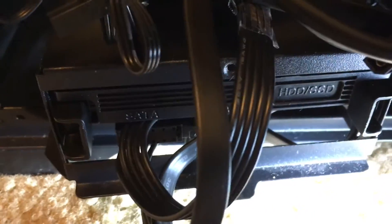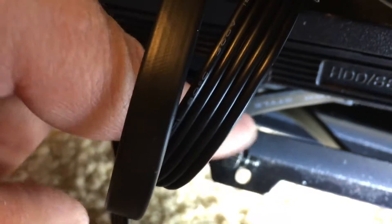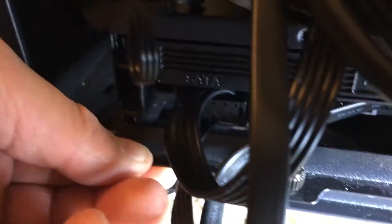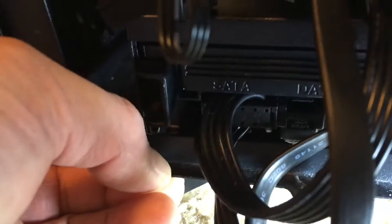I've already removed this, but I just wanted to point out this little screw here. It will be inside the computer in this hole, pushed back inside the slot. You'll be able to see the slots when you remove it. First, just remove the screw, then gently slide this towards you after you remove the screw.